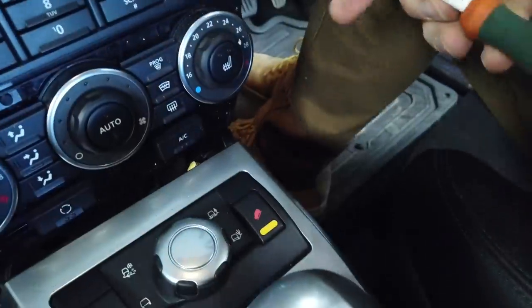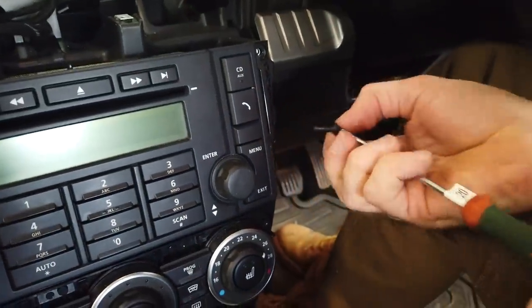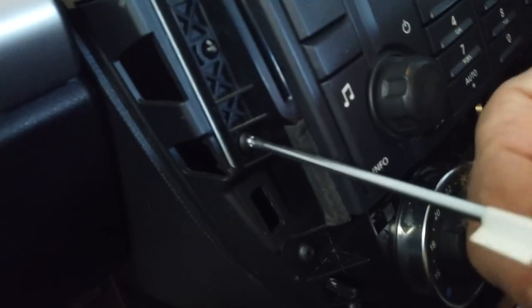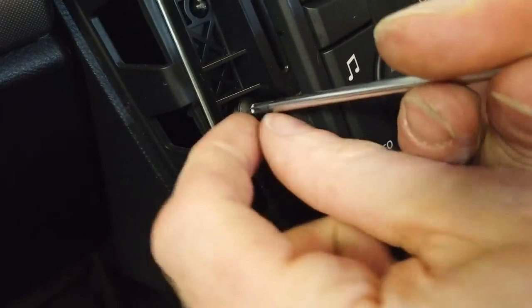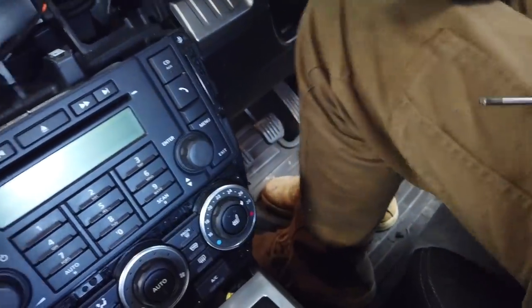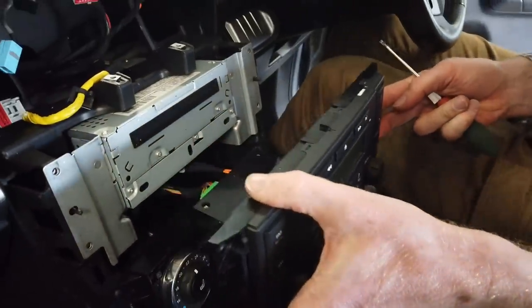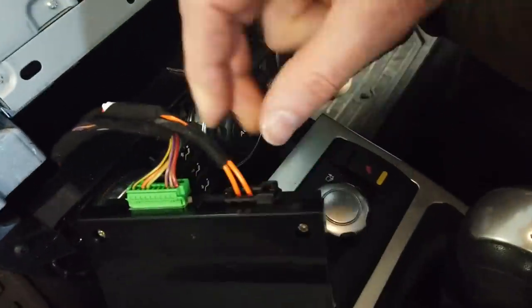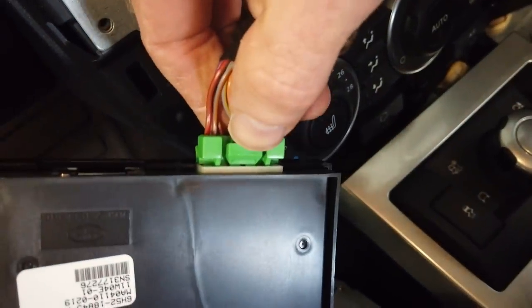There are two middle ones and then another two - four medium length screws hold that radio in. Check them in the pile. Now you can pull the front off - you can see it's just the fascia coming off. When you pull that off you've got a fiber optic most-bus connector that comes off there, and a green connector - there's a little tab, pull it off. That's the face of the CD but not the mechanism.